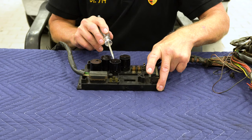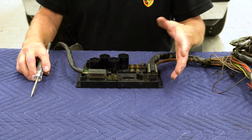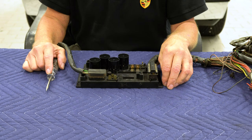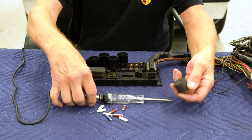I've stripped the relay board down so that you can see this a little bit better, and I've also pried the top off of the rear harness connector, leaving it plugged in. So my car is stranded on the side of the road and I don't know what's wrong. Remember on the 1.7 and 2-liter cars, when you first turn the key on, you should hear the fuel pump run and stop. If you do not, the car is not going to start — no way, no how. It's extremely important to always have an extra relay that you know works, some fuses, a nice test light, and a jumper wire to bypass certain areas.